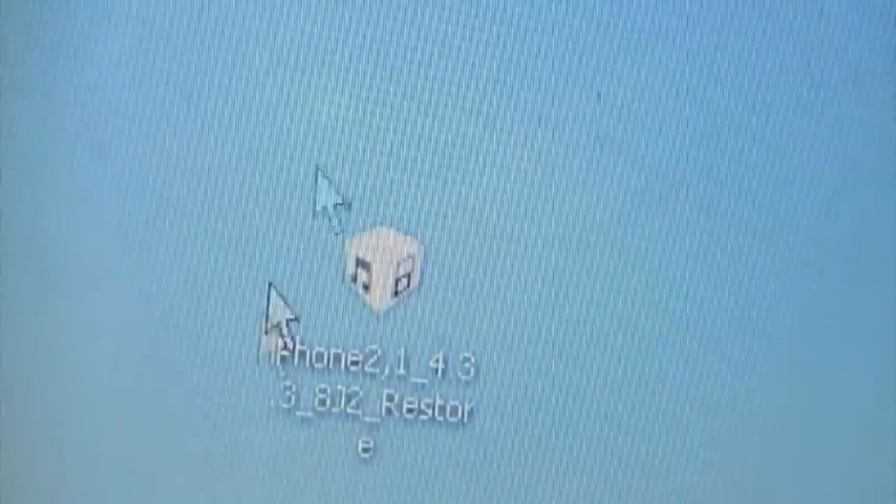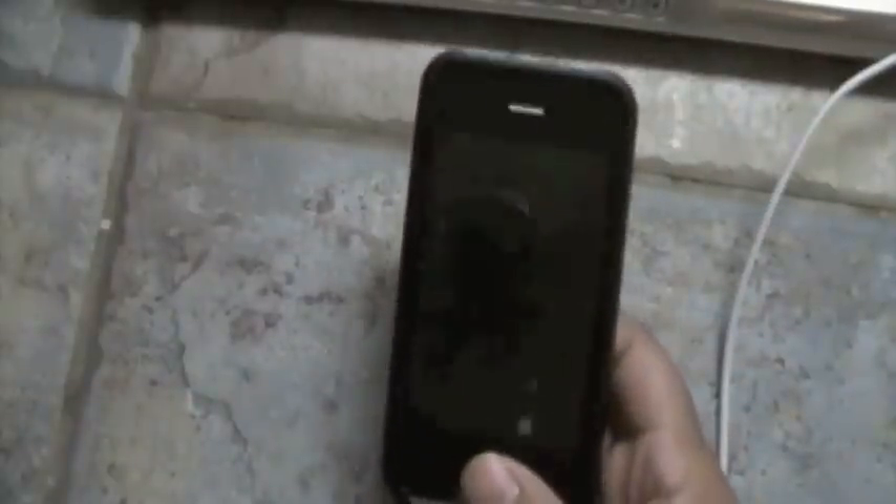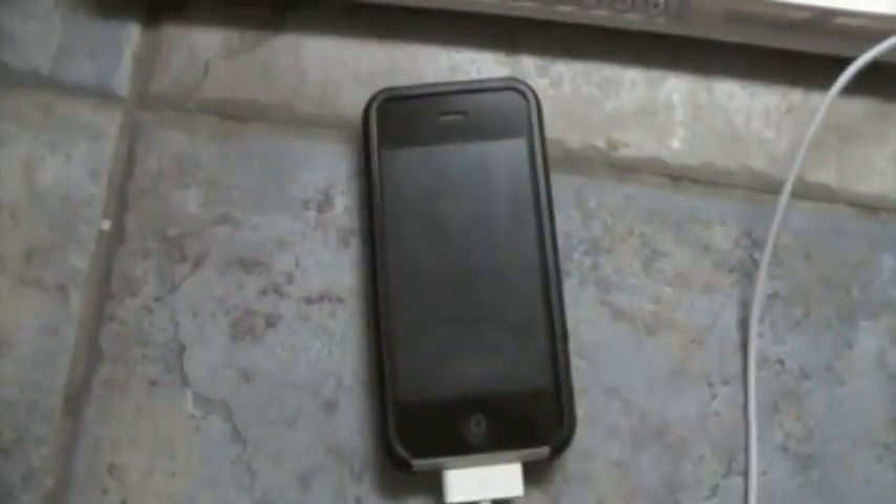It is right here — iPhone 4.3.3. Now what you're going to need to do is plug your iDevice into your computer and put it into DFU mode. This is quite simple. What you do is hold down the power and home buttons for 10 seconds together, or until the screen goes black. After your screen goes black, you hold down the home button only until your computer recognizes that there is an iDevice plugged in.